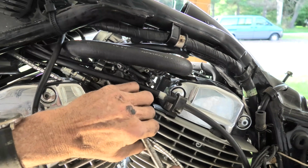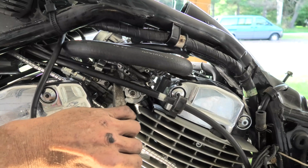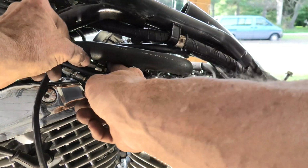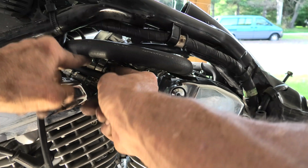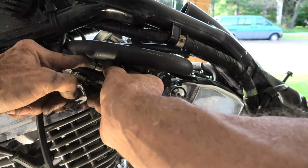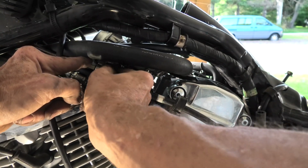Without a doubt, the push cable is being contrary compared to the pull cable. That went really easy, but one way or the other, well, it's back in now. Just have to work it back in, and now we can just retighten the little 10mm nut, which eventually I will tighten with the wrench, but just for now get it finger tight so that it won't fall back out of the bracket. And that concludes the throttle cables.